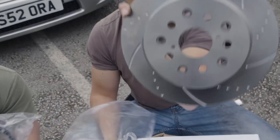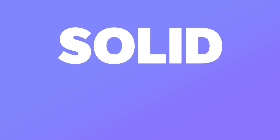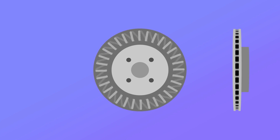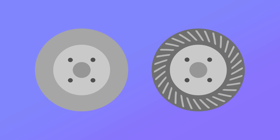Let's look at the common types. Firstly, there are two main types of construction: solid and vented. Solid is simply one solid disc with its two brake faces. Vented discs space those faces out with air channels in the middle, allowing heat to be relieved through them. The vanes that channel the air can be straight or curved to help with additional cooling. It's generally known that a vented disc will do a better job of dissipating heat than the equivalent solid one.